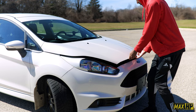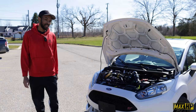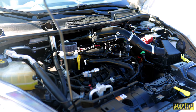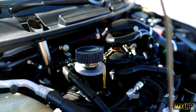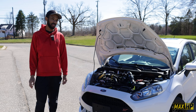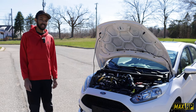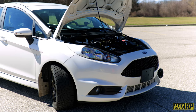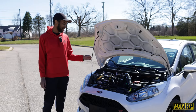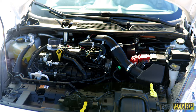Sure. So tucked behind the engine, I have a custom Pulsar turbo kit. I pieced it together myself. It's a stock manifold, but it's been modified. It has a top mounted external wastegate. Also, I converted all the flanges from the manifold all the way down through the downpipe and the exhaust to V-bands. So this entire setup has no gaskets at all. The only gasket is the manifold to head gasket. It's completely just self-sealing. Whoa, that's pretty wild.